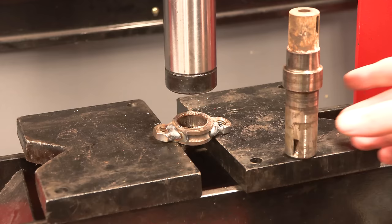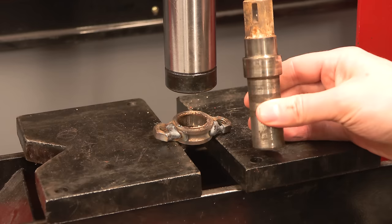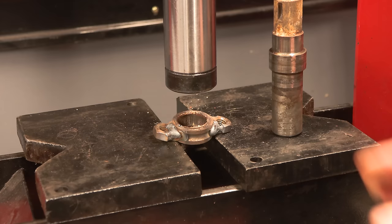Okay, so we've got the first spindle all done. Obviously needs a bit of a cleanup, but I've got the inner race off that broke and the stuck blade boss as well. So now we have the other one to do. So I'll get that done. And then we can work on fixing and welding the actual frame which holds the two spindle houses together.